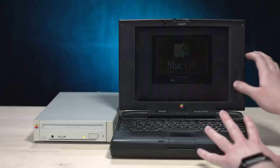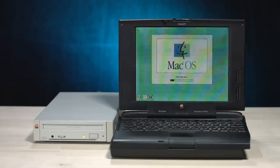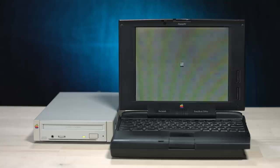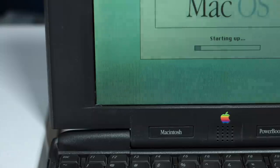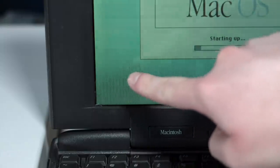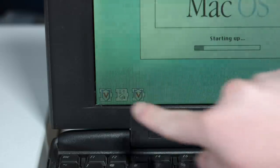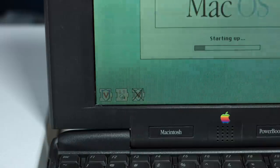We kind of have it. There we go — we just had to jiggle it a little bit. Now it looks like it's frozen. I don't hear the hard drive doing anything. Reboot. Hopefully it works this time. I've noticed these lines showing up as well. I seriously think there's some kind of connection problem between the display and the board. I pushed the display downward and then it started working better.